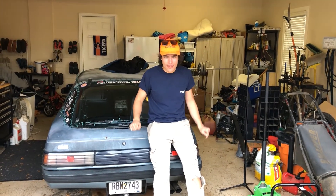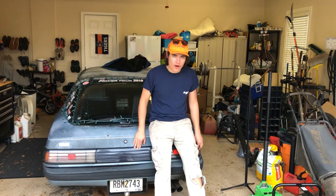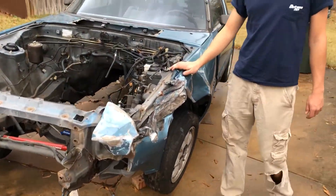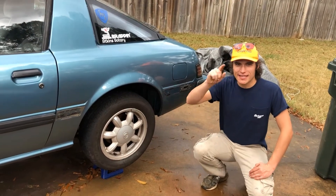Hey everybody, today is going to be a bit of a longer video because I will finally be fixing something that's been a major problem on this car for a while - the rear end. This car does have an LSD swapped into it, but currently it leaks something terrible, like a quart a week, and it essentially identifies itself as an open differential because the clutch packs are so worn out. I need another axle to go into this car while I rebuild this one. This other car had a run-in with a bridge, but it has an LSD that I've now purchased, and today we'll be swapping this LSD into that car.